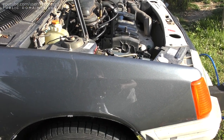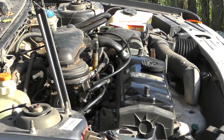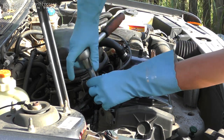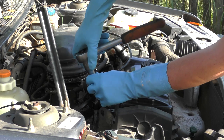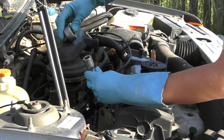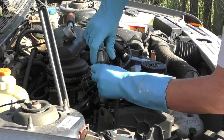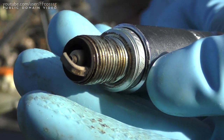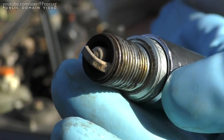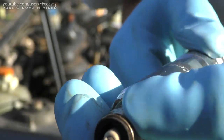Let's just get some plugs out of this thing. That one wasn't even tightened in properly - it was like finger tight. That could have even been causing compression issues. Looking kind of crusty, not too bad though, but this thing has most assuredly seen more kilometres than the plugs in the other Persia.